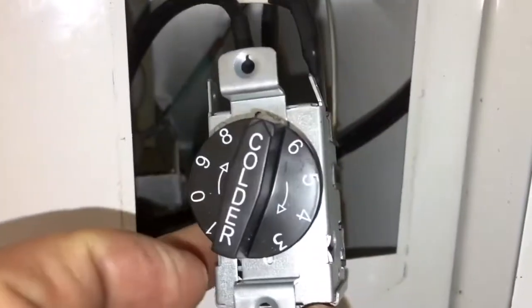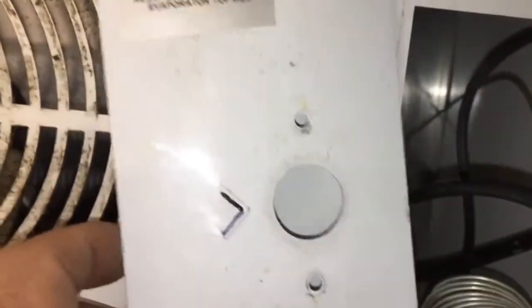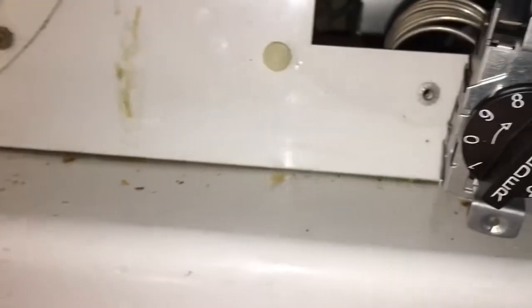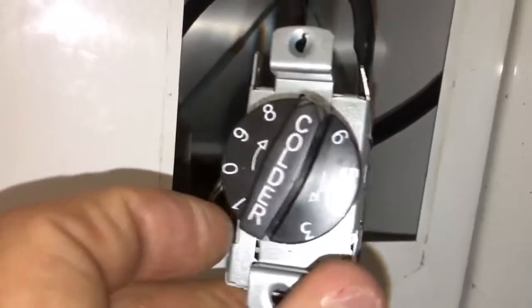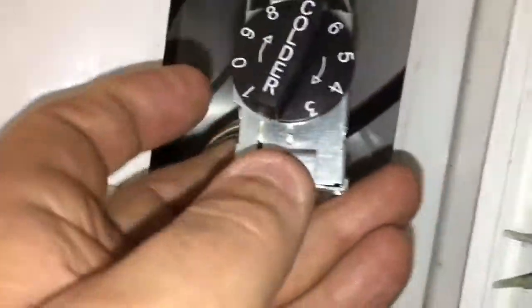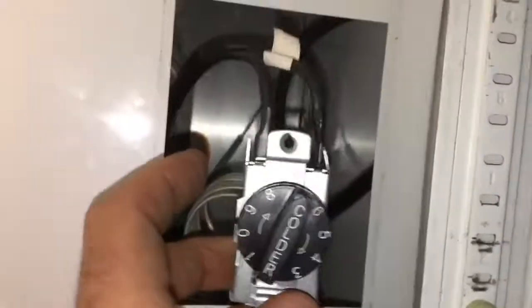It's fairly simple — just two wires, connect right on here. One thing you've got to make sure of when you do a control like that: the panel goes on like this, and you've got to make sure where the arrow is. The zero has to line up, so you want to make sure you get the control right-side up, not upside down. The off position is zero, which is on the left side — that's your zero. So I've got my control right. You just dry-fit it so you know everything's going to fit okay, then put the panel on.